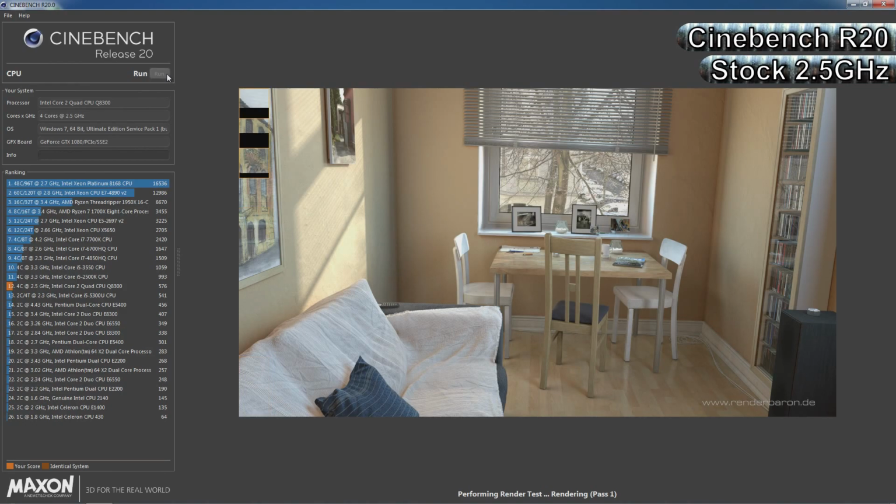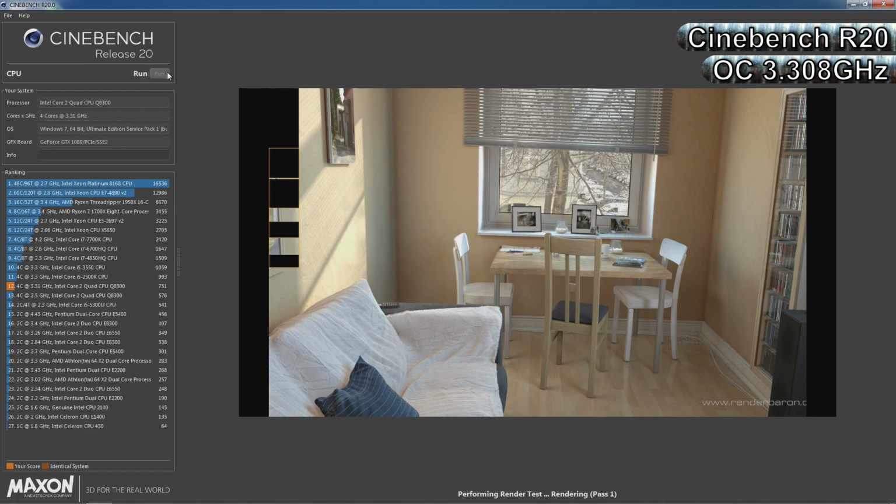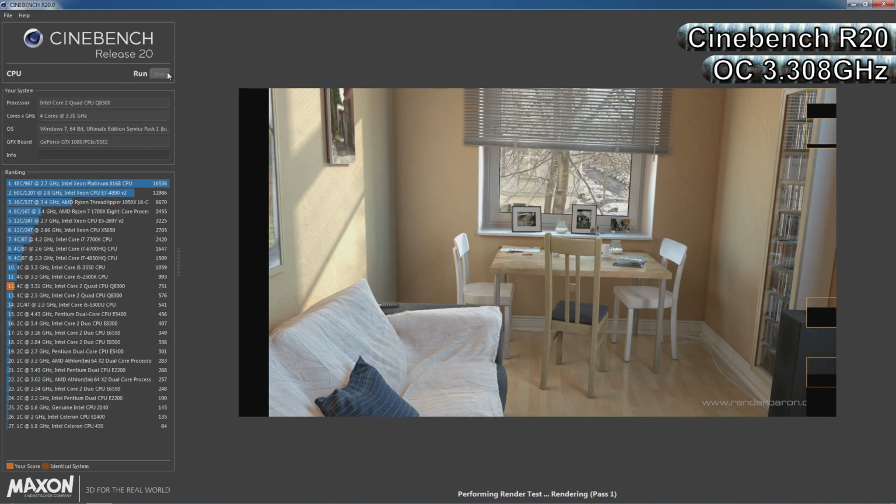At stock, the Q8300 scored 573, 576 and 576 points in the 3 tests respectively, giving an average of 575 points. Now, for the overclock, I had no idea what an actual safe voltage would be, so I set 1.4 volts in the BIOS, which gave me an actual voltage of around 1.344 to 1.36 volts. I'll put the rest of the settings in the description down below.